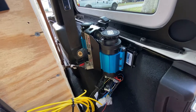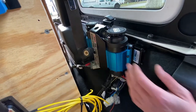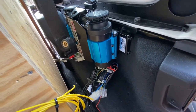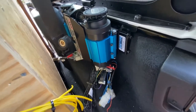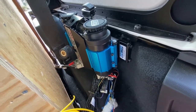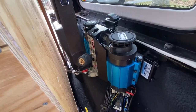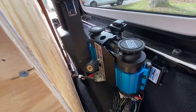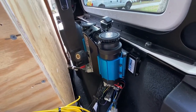All right guys, we got it all done. I got a 45 degree angle air fitting so that the chuck can come out because of the spacing behind here. The switch is mounted and there's a bunch of excess wiring. The wiring kit from this thing includes switches one and two, which are for front and rear lockers if you put lockers in. I don't need any of that — all I needed was the red and yellow wire, and that powers the switch to turn the compressor on. The two air filters are there, the quick release chuck is there, and then you have the switch. It's self-regulated, it's got a fan, and it puts out clean dry air. I think it's going to work out really good.